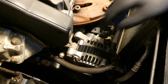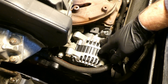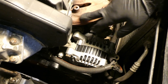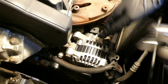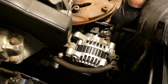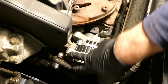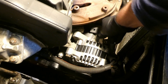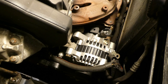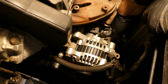For the upper bolt, I tried all possible ways to fit the torque wrench but couldn't get it in anywhere. I'll tighten it by hand to approximately 40 Newton meters. It could possibly be done from underneath the car, but my air conditioning unit is in the way and the bolts are rusty — I don't want to remove that. The bottom one also cannot be torqued with a wrench, so that one has to be by hand as well.